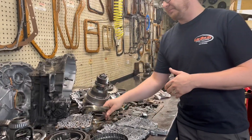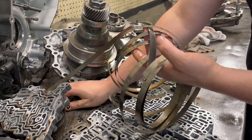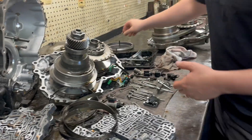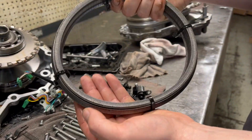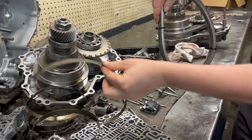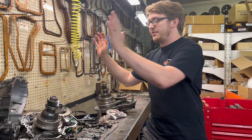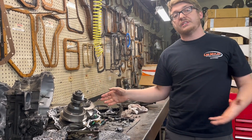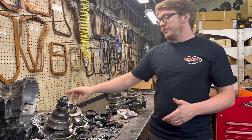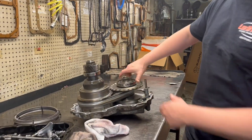What we found here is the belt — they refer to it as that inside of the CVT transmission. It's made up of a ribbon of steel and these tiny little pieces that hold everything together. Here I have a good example of what one that's together looks like — all those little pieces are wrapped around that ribbon right there. The point of that belt inside a CVT transmission is to move these two big pulleys here. This is the heart and soul of the CVT transmission. When power goes in on the primary pulley, the belt connects between the two and drives your secondary pulley, which moves your vehicle. I also have one that is fully intact showing that belt between the two pulleys.